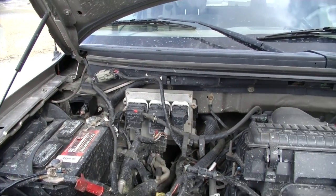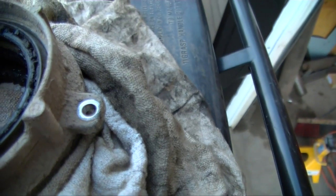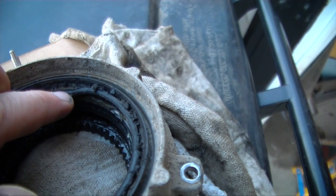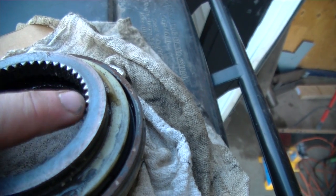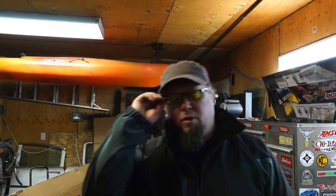That's all in place, everything is patched up. In the end, was it the vacuum switch? Maybe, maybe not — I'm leaning more towards the problem being the seal blown out of the vacuum hub. As you can see right there, the damage done from grinding. In the end, it was the seal that had failed due to a bunch of dirt, which ripped the seal apart, causing the vacuum to either leak or not leak. That's why the hub was engaging and disengaging repeatedly.